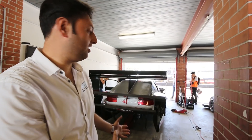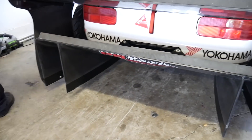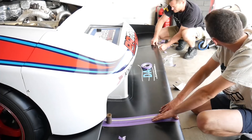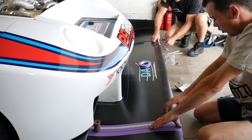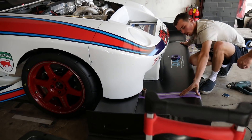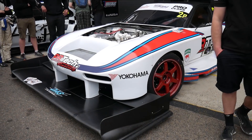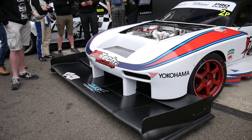The RP968 was designed initially trying to maximize aerodynamic efficiency. The biggest contributors to that are the very large diffuser this car has, as well as a very large splitter and canard overhangs. With the front end, there's obviously a dual element wing. What was the logic behind going for that instead of a splitter design with a front diffuser, and what's the advantage over even just a single element?